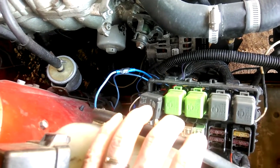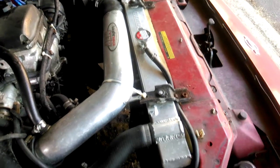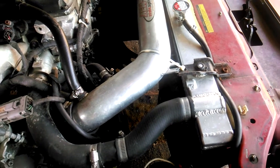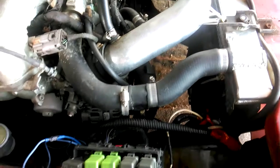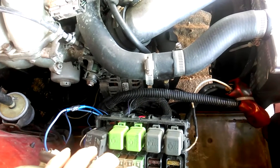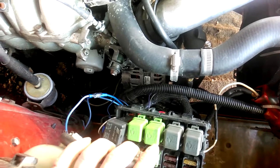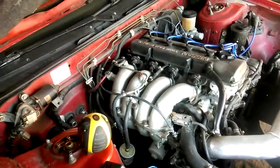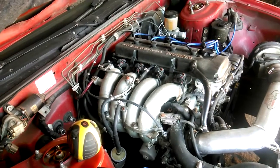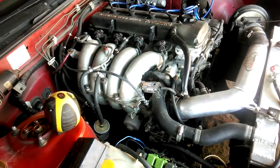But you wear out your fan really fast that way. On my car, my fans barely turn on at all — maybe because I have a Mishimoto double-core rad and a cooling panel. What I did instead is I have a water temp gauge inside, and that water gauge has an output signal. I can program it so that when temperature raises to a certain degree, the gauge will close the circuit, send a signal to my relay, and the relay will kick in and turn on the fan.